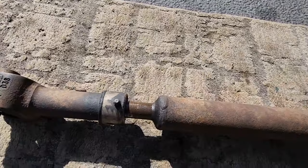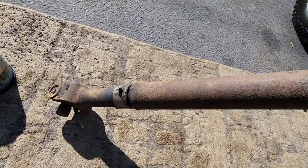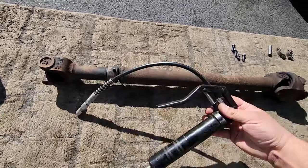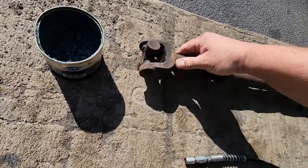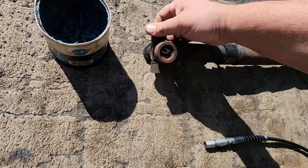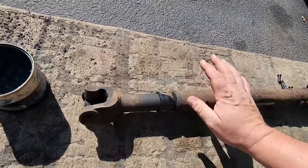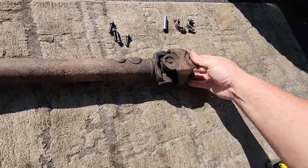Notice we have a sleeve here. This is a sliding drive shaft. You wanna make sure when you use a drive shaft, it's not seized. This one slides back and forth. We also have a zerk fitting right here for grease. So you're gonna want to have a grease gun over here. And also I got some axle grease on hand because I'm gonna grease these caps. Careful with these, needle bearings will fall out everywhere. I should probably take them off that way. There, we'll throw some fresh grease in there. We'll grease up what we can. Got a nice stock factory XJ drive shaft for the front, double cardan over here.